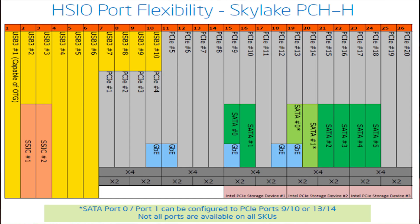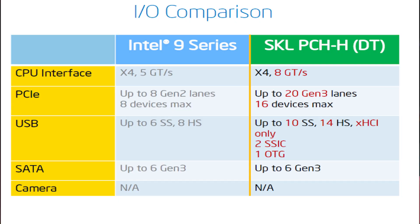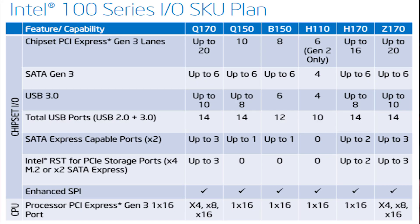The platform has PCI Express 3.0 support throughout. On Z97 it was a split deal — PCIe 3.0 from the CPU but a DMI 2.0 interface to the chipset. Skylake replaces that with PCIe 3.0 across the board, giving you effectively four more PCIe 3.0 lanes than with Haswell. Those extra lanes won't run three graphics cards, but they'll help with USB connectivity, SATA Express, and SATA peripheral connectivity.